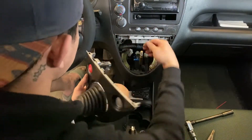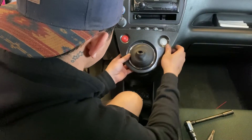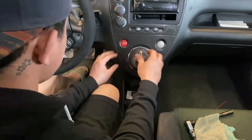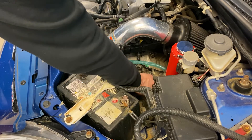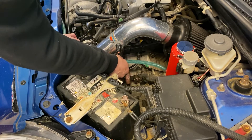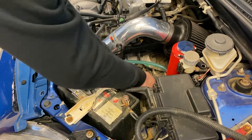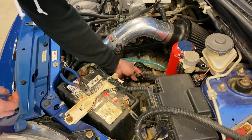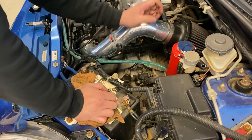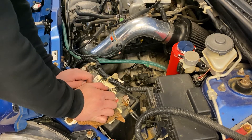Don't forget to plug in your hazard right here. Now we're here in the engine bay. We're just going to take this shifter linkage bushing now. All we need to do is just remove this clip right here. Now remove this kind of plastic disc right here, set it aside as well. It's free right here. We'll probably go remove the air box or air intake right here so that we have enough room.